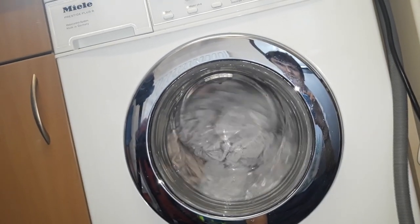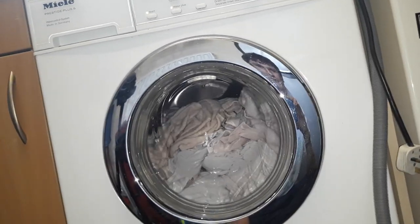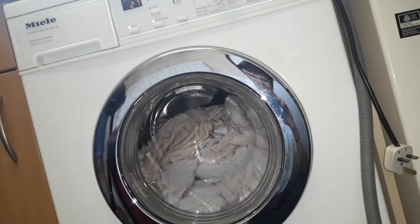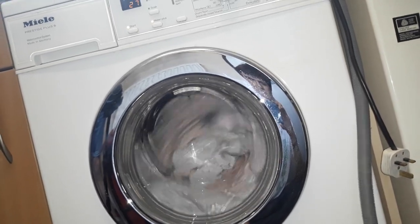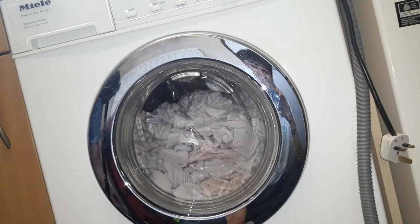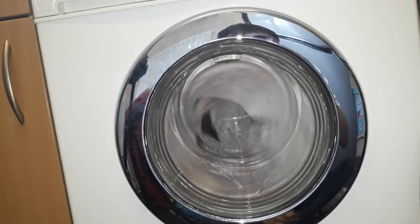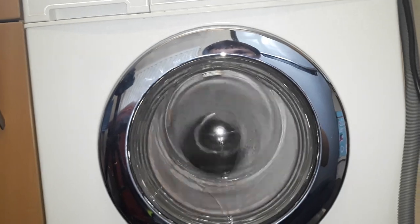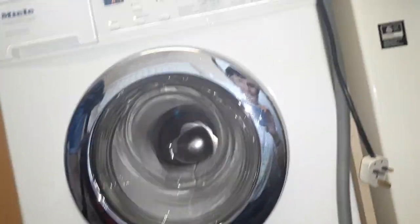This rinse is shorter — about 5 or 6 minutes. That's because it's the extra rinse. The final rinse I don't think fills to high level. I've figured out what it is — if the machine fills all the way it would dilute the fabric conditioner, so the final rinse is always lower. That's going to cut out — that front panel is trying to come off.